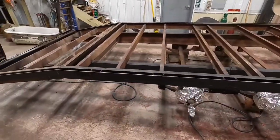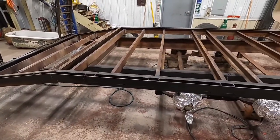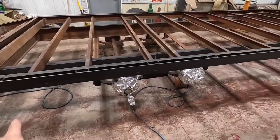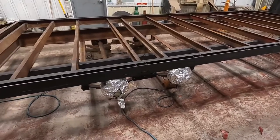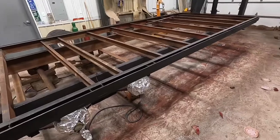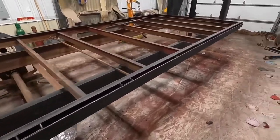All right, I figured I'd just show you this real quick. It's cured for about 2 days. I let it go for 2 days at 55, just to make sure everything's gonna be done. And I sanded down with 220 instead of 320. It says to use 320. I use 220 on this, just as it's gonna be a single stage. It's not a show car, it's a trailer.